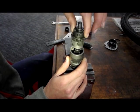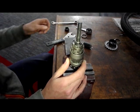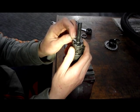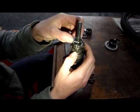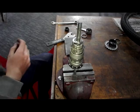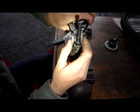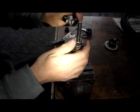Next we install the planetary gear assembly and just wiggle this into place. Then the circlip — there should be enough clearance in this circlip groove to get the circlip over without rubbing against the planetary gear assembly. Then we get the inner jaws of the Leatherman and clip this closed, making sure the circlip doesn't ride up.